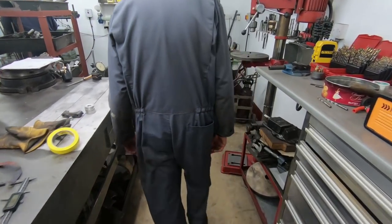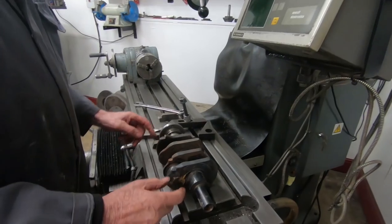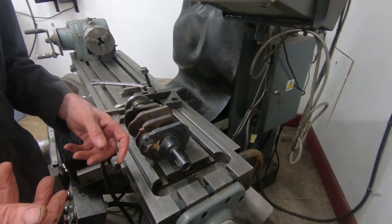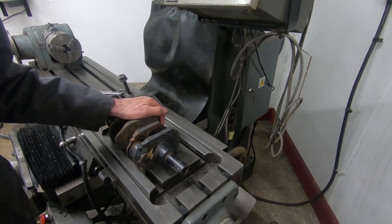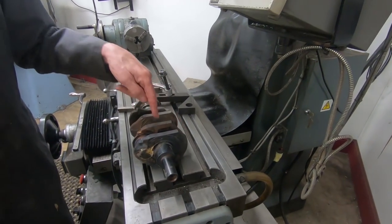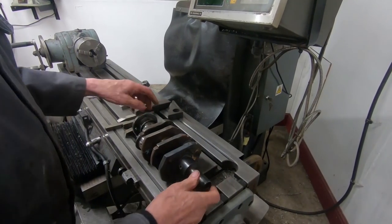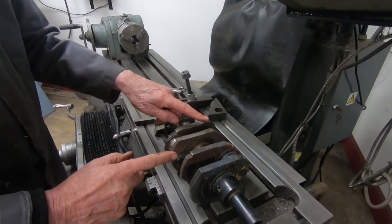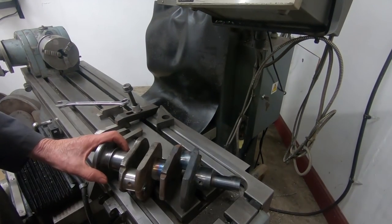Yeah. Well, when we've done this, what we will do, we will put that between things to see whether it's statically balanced. And if it looks terrible, then we'll probably take it and have it balanced. Yeah. And they just grind lumps off of there, you know? And obviously that one there, that's funny, look, we'll have to machine that at an angle. But we do that. No, that's going to be good.